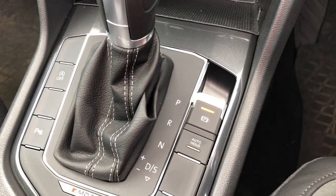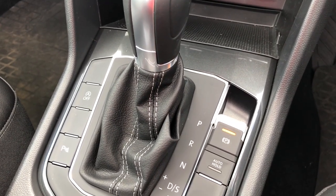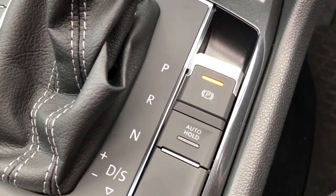So what have we got down here? We've got a rocker switch and we've also got an auto hold button. With the manual gearbox on my Golf, the auto hold would only ever work if the seatbelt was on — in this automatic car you don't need your seatbelt on for it. Realistically, you never have to actually touch these switches down here: as long as you've got it in auto hold, the car will set the handbrake when you get out and disengage it when you start to move off. The only reason you would operate the handbrake manually is if you want to drive the car with the door open.